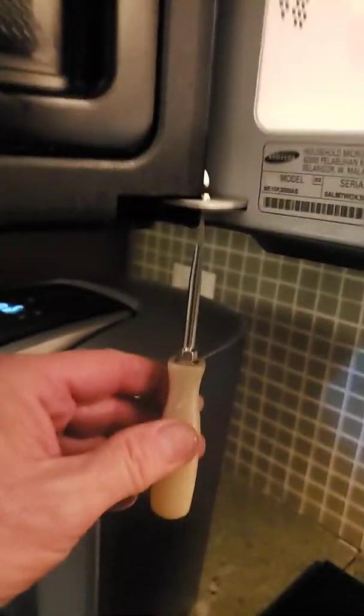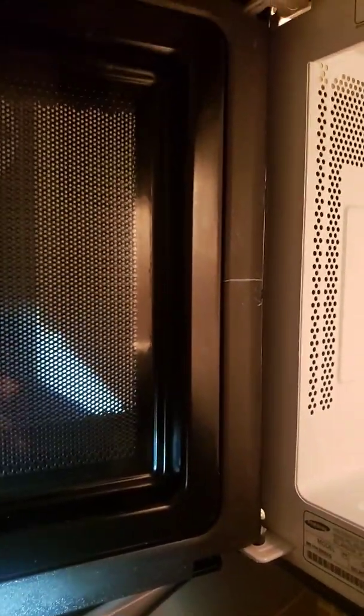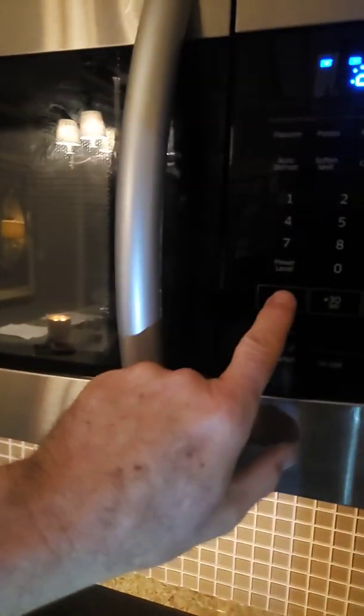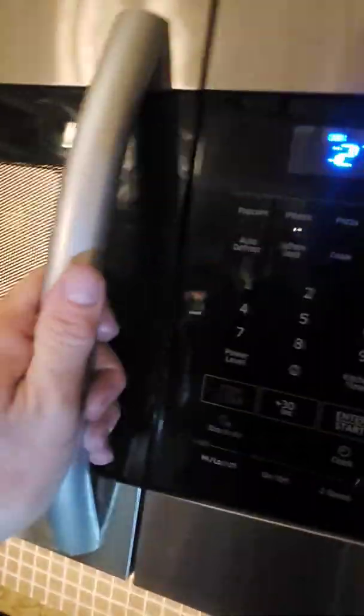This is what I did to fix it: I just took a little screwdriver — the bigger the hammer the better — put it up here and just tapped it until this comes up level. The other hinge was bent down also, so I tapped that one too. Now I've got very minimal flex. The microwave works just fine and it's not shutting on and off like it was before. That hinge is going to make all the difference in the world. Somebody bent the hinge, causing the latch not to hook properly, making the microwave either cut on or cut off.